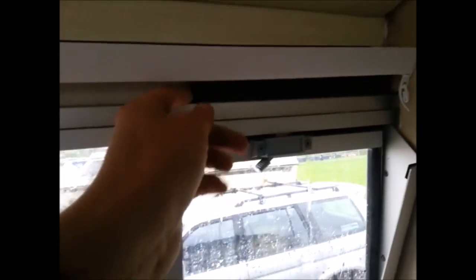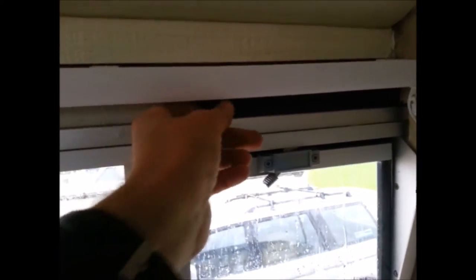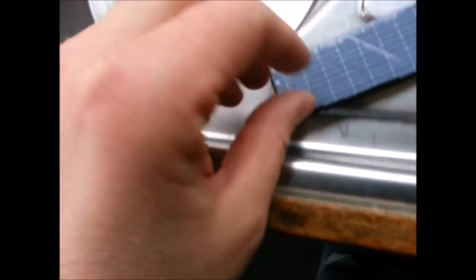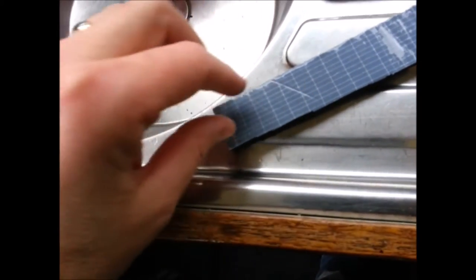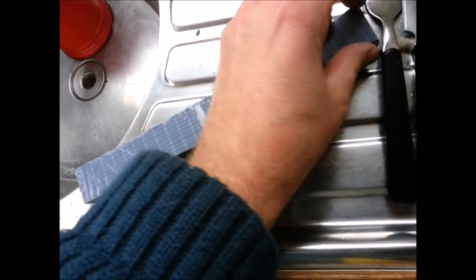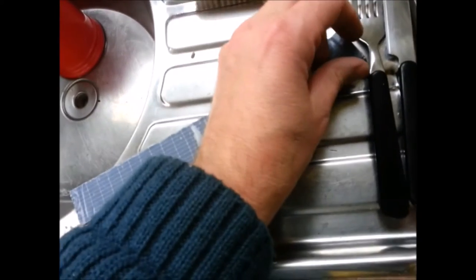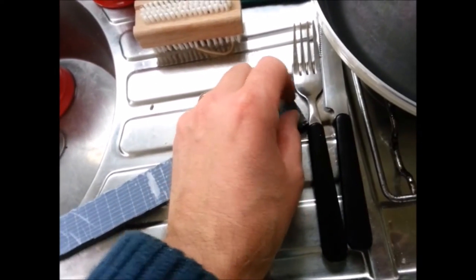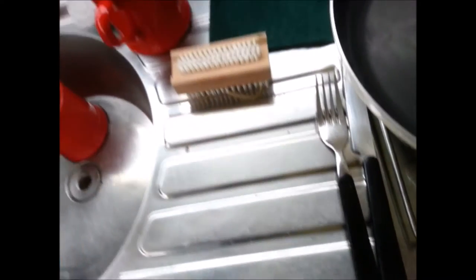Armaflexed underneath the kitchen area, and now we're doing this bit. Just a word on Armaflex. I've obviously cut that bit and popped it in there to make sure it fits. Now on the back we've got this strip, so just unseal the strip, and there's a layer of sticky glue on, which is excellent. It's much easier doing this than spraying it with glue.